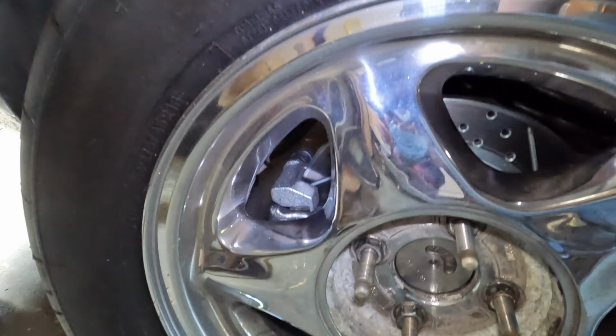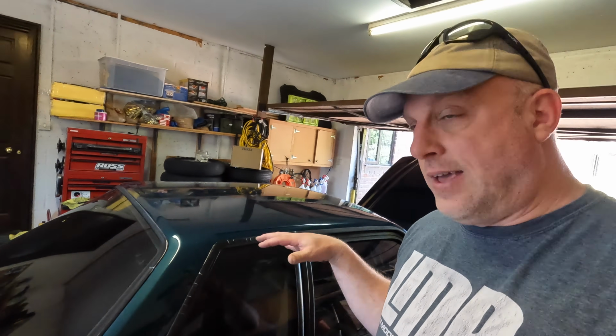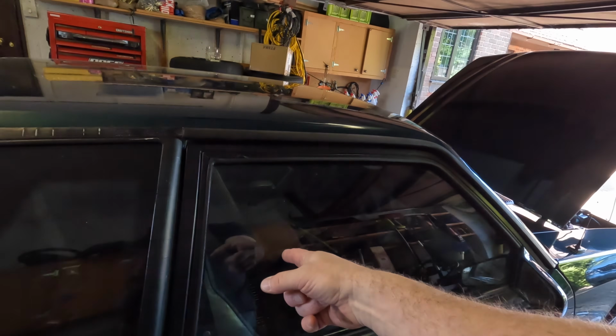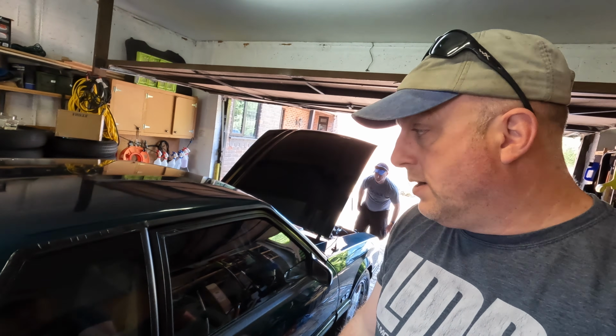Parking brake. This works really well. I've got to admit, from me doing it the old school way of Thunderbird Turbo Coupe brakes, SN95 brakes, the cables that are supplied work without that Ford Racing adjuster for your handbrake cable. So I was really pleasantly surprised about that. They must have just modified the length a little bit to work with his custom cables, and you know, one less thing you have to buy and worry about. So that's why he didn't say we needed it when John went to buy his parts.